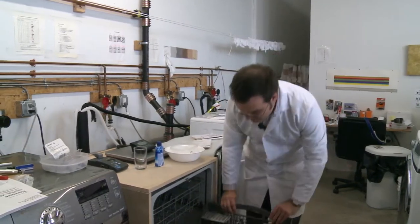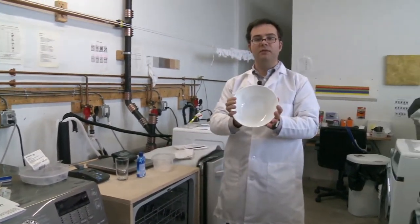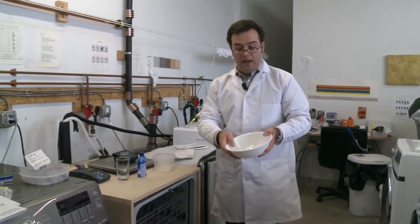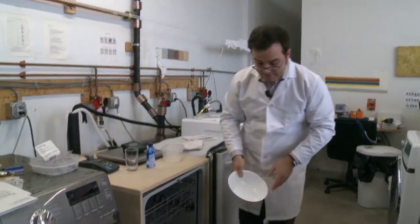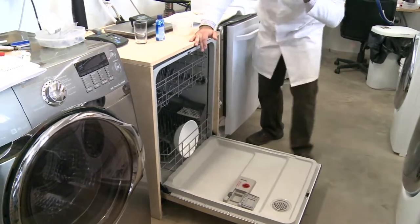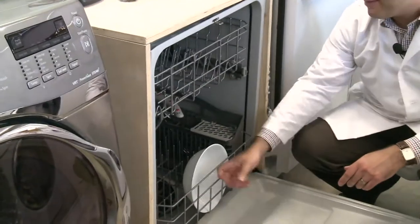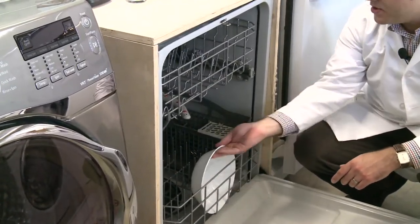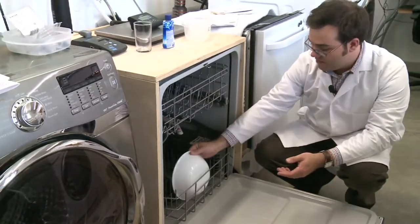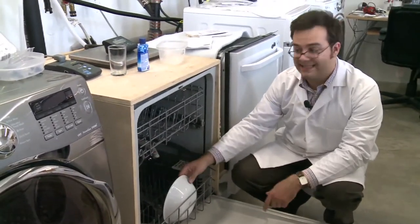People find that occasionally large items like this bowl will either attract dirt from other items that were in the dishwasher, or it'll just fill up with water or it won't get clean. First of all, if you put it in like this and close it up, you see how in here these jets are meant to spray up — nothing is going to get at this and clean it. So you have to make sure that any sort of concave surface like this, you put it in facing where the water jets are. And that's how you make sure that the inside gets clean.